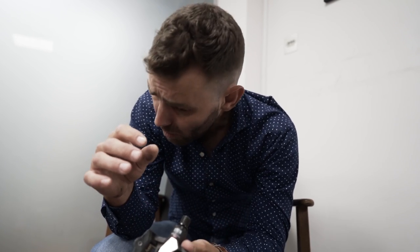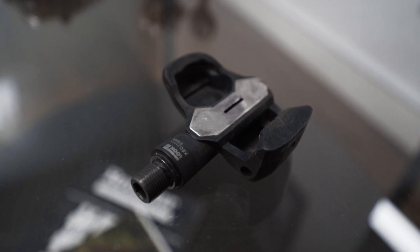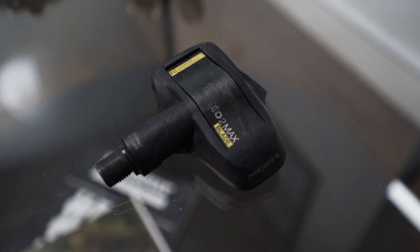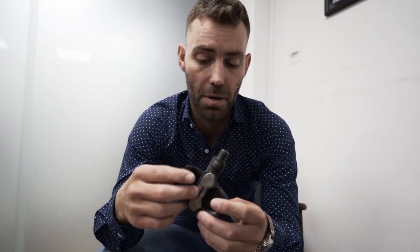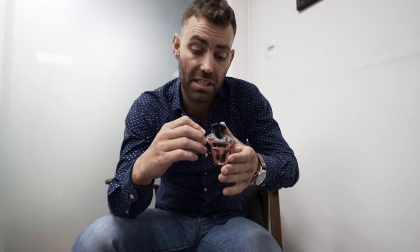It's quite heavily rear-weighted, which tends to make it easier to clip in and engage. This is the original clipless pedal system, which comes with three different options of float. This is one of the older versions — they've more recently moved to a carbon leaf spring. The benefit of the leaf spring is it's lighter, but it lacks any form of tension adjustment. They offer several different levels of tension, but if you don't like the factory-set tension there's no way of deviating without removing and replacing the leaf spring. There are titanium axle versions along with a series of steel, stainless steel, carbon, and plastic bodies.